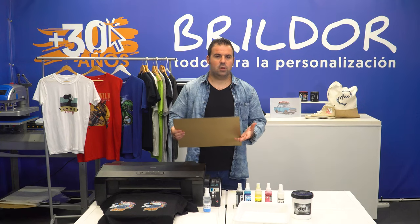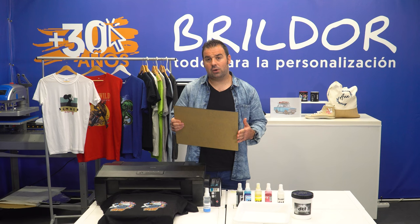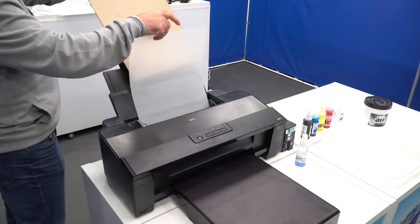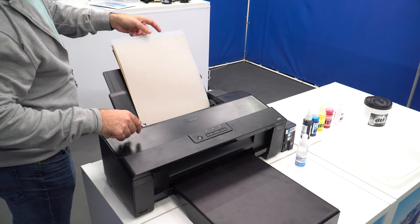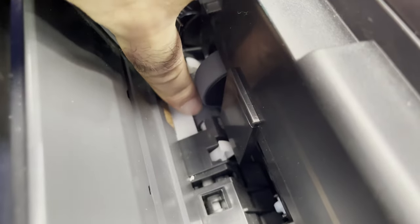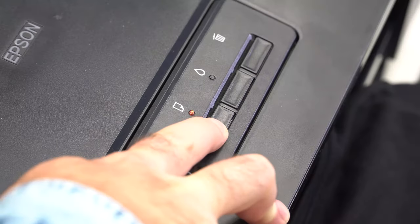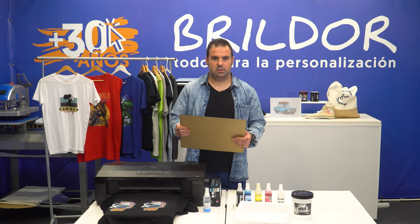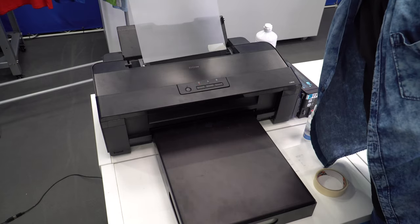Film feeding problems. One of the most common issues is film feeding — either because the printer fails to grab it or because it spits it out. One of the most effective solutions is to place a board or a few sheets of paper in the paper support to stiffen the film so the printer feeds it correctly. There may also be dirt on the paper feed rollers located on the right side facing the front of the printer. To clean them, use kitchen paper soaked in alcohol, place it against the roller and press the paper feed button. Finally, if nothing has worked, put some masking tape on the back corner of the film to prevent it from slipping when feeding.